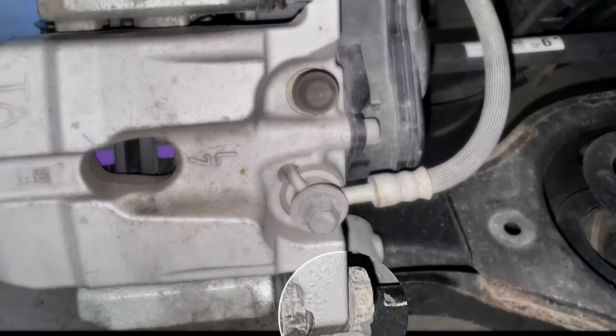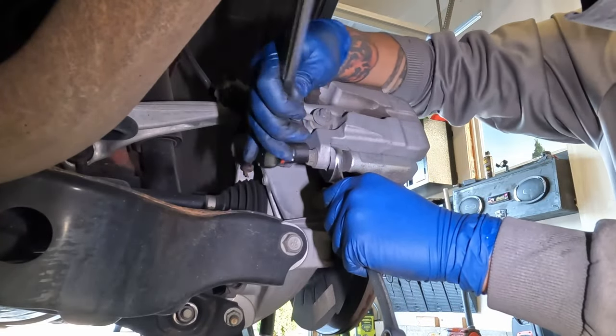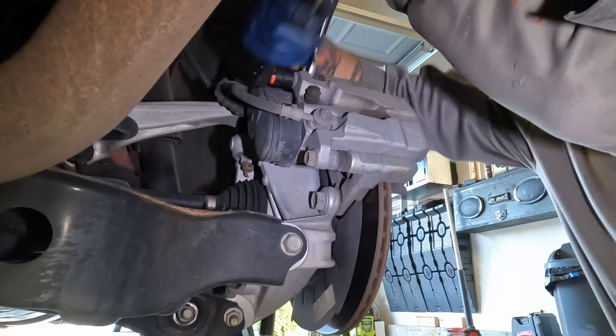You don't need to spend any money on this — just use wire and terminals you have lying around, or pick them up at Home Depot or an auto parts store. As long as you have a 12-volt source, you're good to go. To remove the caliper, use the 14mm socket on the outer bolt and the 17mm wrench to hold the inner nut. Use both bolts and remove them — I use a power tool to speed it up.